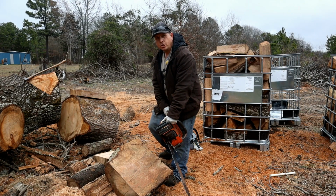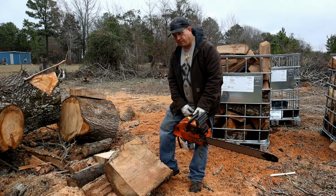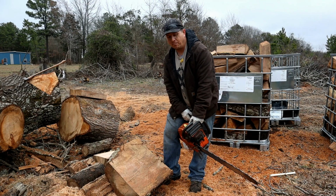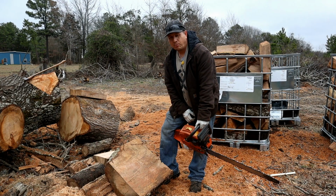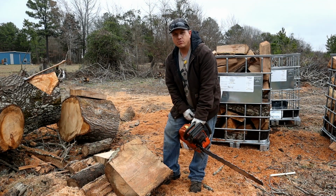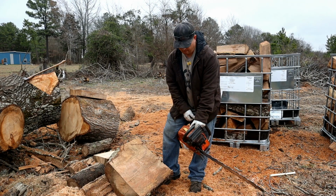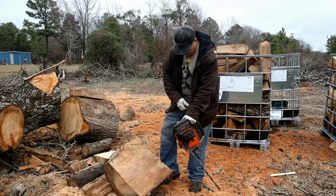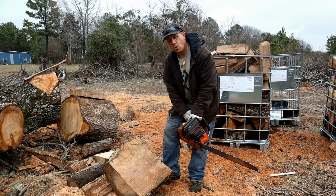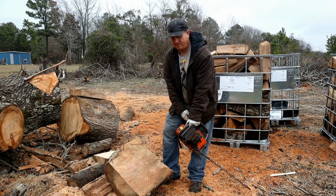We'll start off with the 281. No decomp on this one. Matter of fact, no accommodations for a decomp. So you gotta mean it when you pull this over. Pretty sure I did machine work on it. May not have, though. But the squish is right there at the 20 thousandths everybody's looking for. So let's try it out. That's good. Pulling this over more than a couple times is not fun.